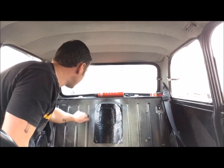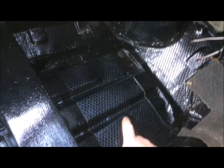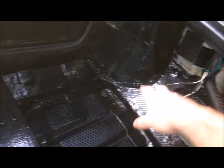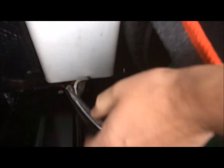One tarmac sheet applied. This is how I've done my rear floor panel — I've got three sheets there. In the front I've got one on the footwell, one on the wheel arch off-cuts, one on the front, same again on each side. I've got about four sheets maybe on the boot, just under the spare wheel, underneath the back box. I've got another one on the wall on the left side and all around the battery box. If you look at the side panels in the back, you'll see the original manufacturer's sheet — just one sheet straight across the panel to kill the vibrations. It'll be the same underneath your headlining: probably two or three sheets across the roof, just to stop any tin-sounding twangy noises. I'll probably put another couple of sheets on top of the rear wheel arches and then call it quits — I think that's a pretty good job.